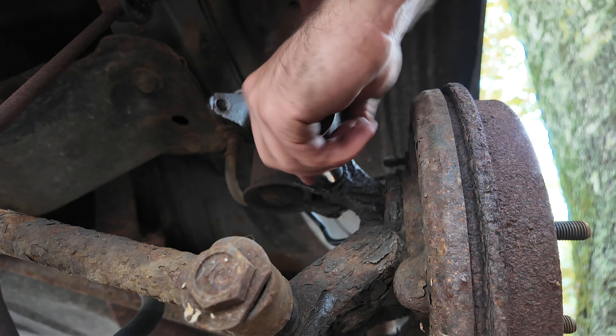Pull those out — he's disconnected. For the brake line I do not want to use any force; although it's been sitting in there for a while I'm just going to wiggle it out gently. On the top side we have three 14mm bolts: here's one, another one over here to the side, and one behind the seat belt retractor right in here.